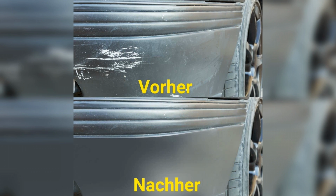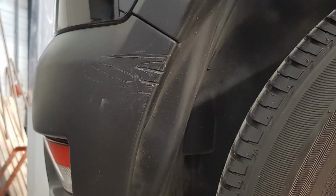Do not wash newly repaired paintwork with water for 4 to 6 weeks after the time of repair. For optimum, long-lasting results, use only soft chamois leather when wiping the surface. Intensive, aggressive cleaning methods such as high-pressure washing should be avoided to allow the repair components to dry properly. After the 4 to 6 weeks, regular maintenance should be observed.